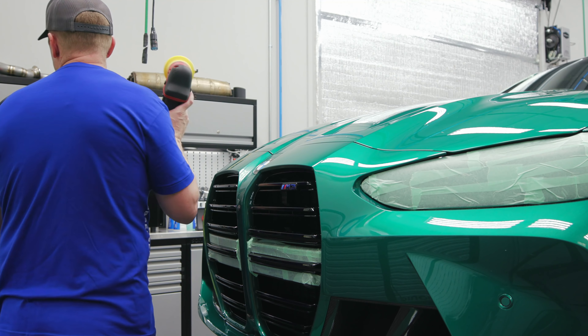A little Jeskar. So this is what I've been doing on the surface of the car — I have my little one-inch on a dual action mode on the little Rupes and I've been hitting some spots to see if I have a deeper scratch that the Perfect Finish isn't taking out. I'm treating this like this would be my M3. That looks like a glance of a rock or something stuck there — and that's definitely from a bug, and of course you need to refinish that.